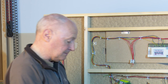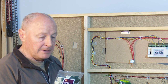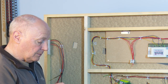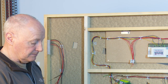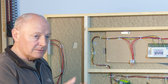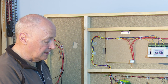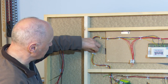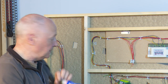So what I have found instead is B&Q do a bag of 250 self-adhesive pads for £2.50. So straightforward, put them on there. But what I would recommend is that you peel off the sticky pads and glue them on, because what I found on the Chadwick TMD was after about 6 months, the sticky pads lose their stickiness and the whole loom starts to drop away from the bottom of the board. So by all means, try these, but be warned that the sticky pad might not work forever. But using these pads here with Evo-Stik Timebond works fine for me.